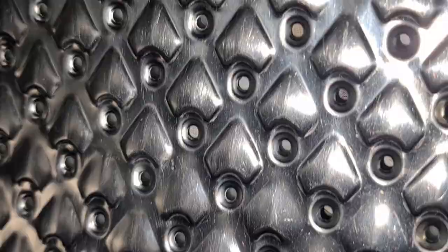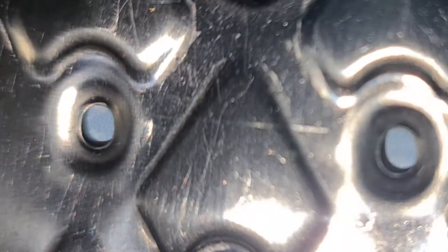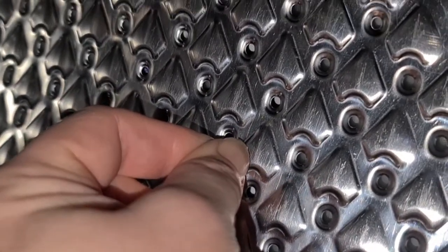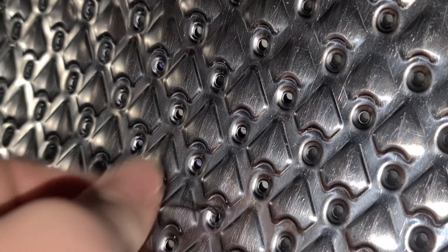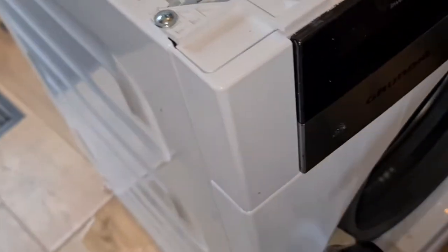There you can see little shimmers of blue — that will be a fiver. I was going to try and hoover them out. I did try spinning the drum a few times but it wasn't releasing them; it was just sucking them back further. So I took to poking at them with a little wire. If you can see your money and you can stick a piece of wire onto it or just above the note, you can pry it in a downwards direction. I'm grabbing hold of the note and pulling the drum down, gradually pulling the notes down to the bottom.